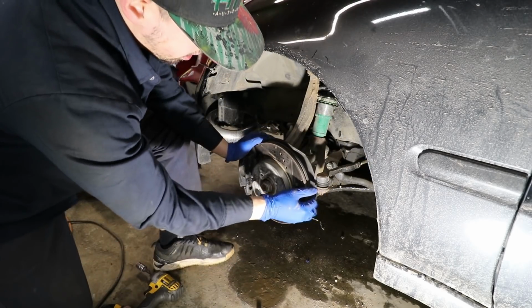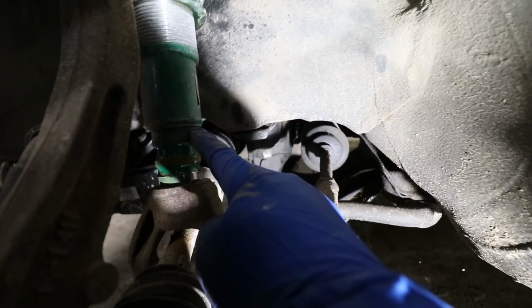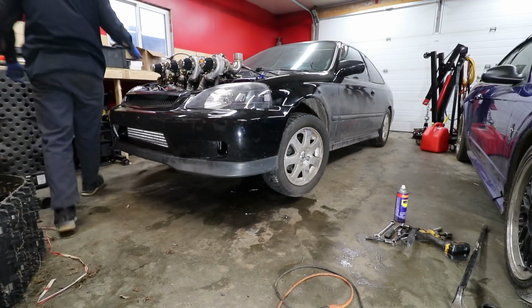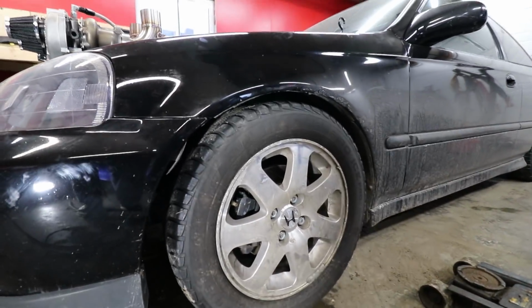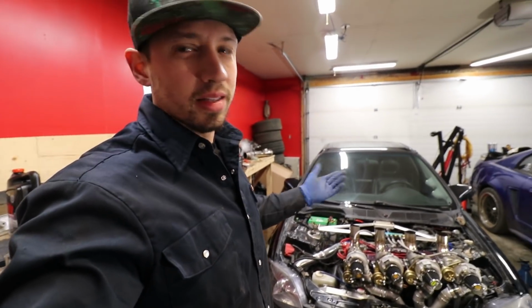I wonder if that's slotted. Well, that was stupid, Kyle. I think I stand corrected. It looks like we can actually put our bolt through this, so we'll gain probably an inch of clearance on the shock right here. Driver's side is raised up, the passenger side is not. So I'm gonna drop both sides now and see the difference. So it's only like 2 inches maybe, this side. Like flush. There is a sway bar in there that's gonna try and balance it out, I guess.